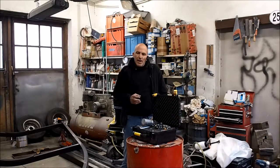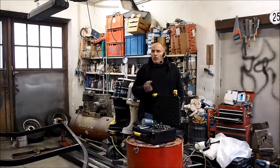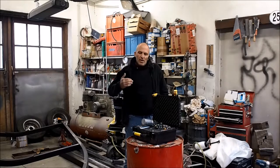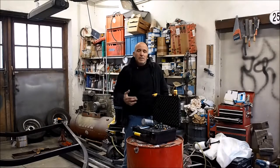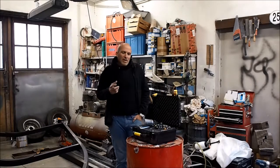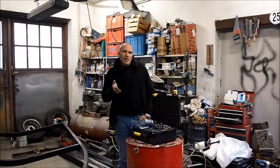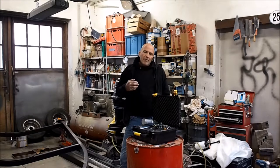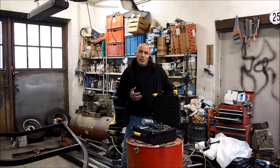The thing with the clear binder is that it basically just works as a glue for the flakes, and it dries really fast, and it allows you to build a couple of layers in a reasonable time, and you don't get these super thick layers, because always keep in mind you have to put clear coat on top of that. So in the end, you will have far too much material on the surface, and if you have a little bit of bending or whatever, especially on a boat, it will crack.